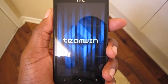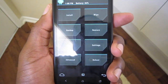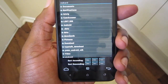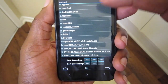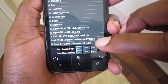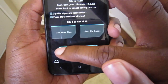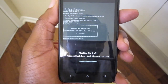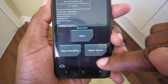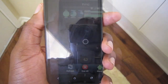Okay, so we're in recovery — TWRP 2.1.8 — and there is no wipe needed, so we don't have to wipe anything. All we need to do is go into install and locate our dual core mod ultimate version 2.1.8 zip. We're going to slide to flash and it should be really quick — yep, very quick — and then we're going to reboot system and meet back up when things are finished rebooting.